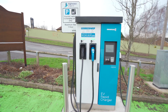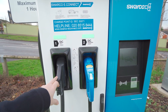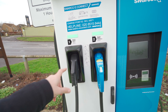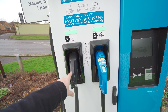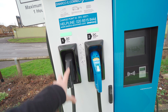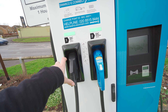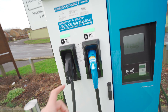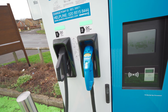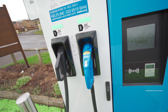On this charger you've got both a DC and an AC charger. You've got a CCS connector, which is like a Type 2 but with a combined bit underneath — this will go on later things like the later Renault Zoes, Jaguar I-Paces, Audi e-trons etc. You've also got a CHAdeMO charger, used on things like Nissan Leafs — that's a quick charging connector, but on Nissan Leafs you actually have a separate connector for charging at home.